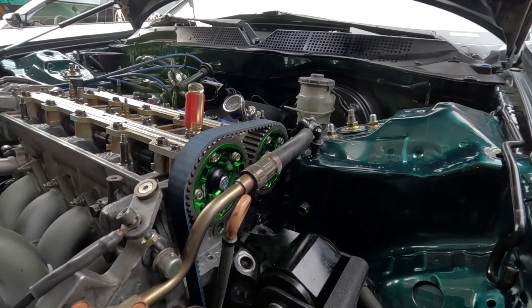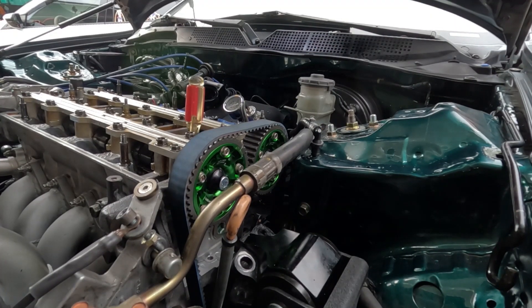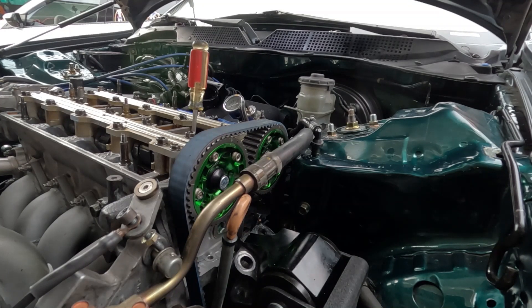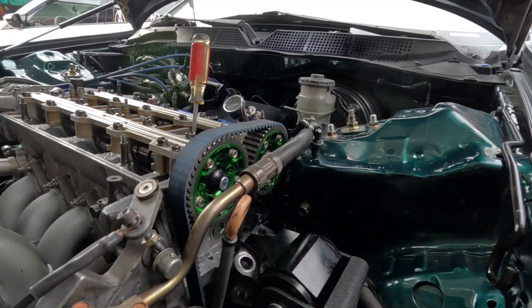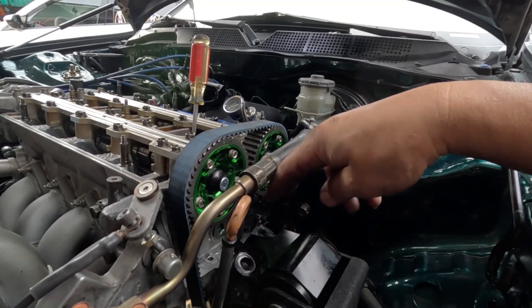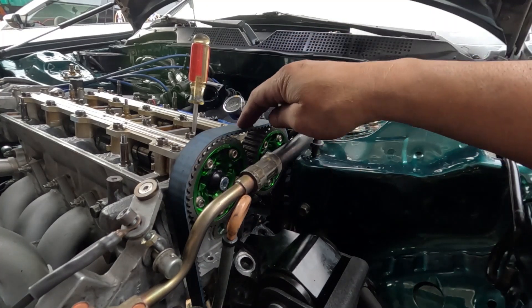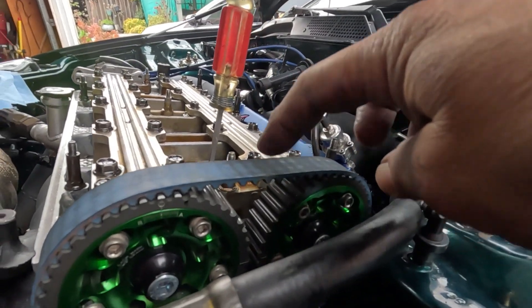I think it's much better this time. Before you could see this thing bulging on some spots, but now you hardly see it. I'm gonna line up the two dashed lines right there. Yeah, it's better. That is how you set your timing belt tension using the manual tensioner. Just keep trying till you almost get rid of the flex. Yeah, this time it's much better.